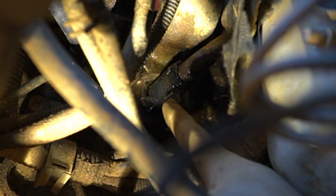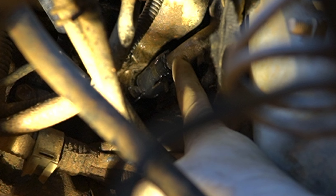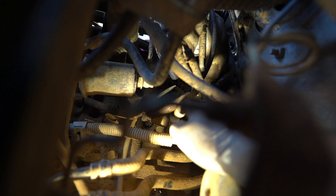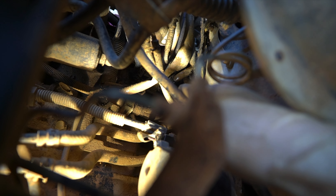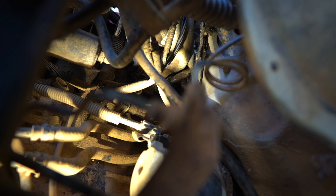Looking at the back in the driver's side fender well — remove the front wheel — there is a really short hose, maybe two and a half to three inches long, going from a metal pipe to a metal nipple that runs down from that elbow. I replaced that; it is a little tricky to get to, but removing the wheel makes it a lot easier. Just to the left of that is another brand new hose that plugs onto a nipple on the engine. These are not easy to get to, but you should go ahead and replace them while you're in here — that short little one is a very common leak point.